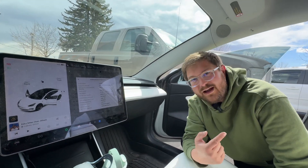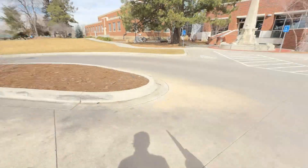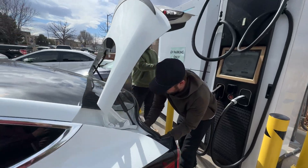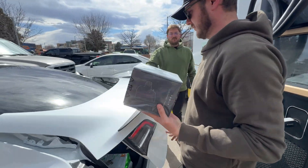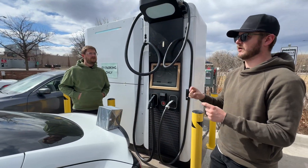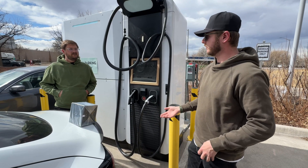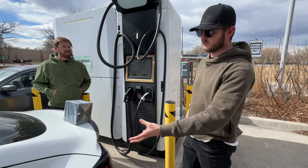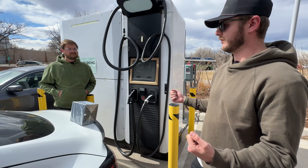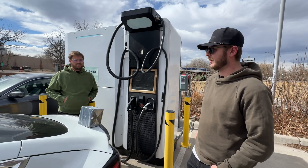Let's talk about what the process was. This is something I recently had done on my Model 3 as well — it was a 2019 car, which required the upgrade, so I was in a similar situation where I couldn't charge here. You have mobile service come out to your house. You do it through the app — go to service, then it's an upgrade feature. Mobile service comes out, which I think is standard for doing the CCS retrofit. All they do is change a module on the inside of the charge port — they pull the liner back, unscrew some things, unplug one thing, and put it back together. It took all of 20 minutes including a software update, then they handed me the adapter and I paid through the app.